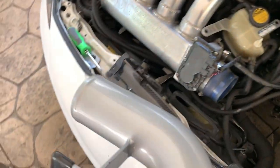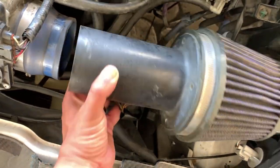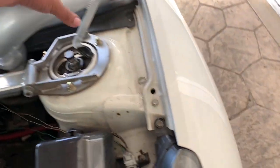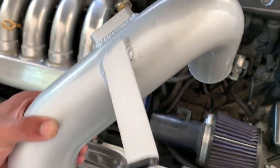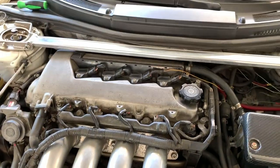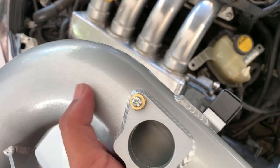This one is two and three quarters inches and this one is a three inch — it's too much for it, plus it doesn't have that vacuum nipple. We got a cold air intake that we're just gonna cut up. This one has the nipple we need. It's a lot smaller, so maybe with that we don't get so much air in and trigger the system to run lean.